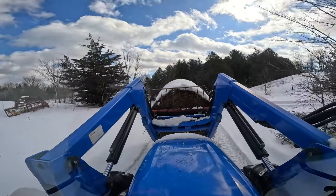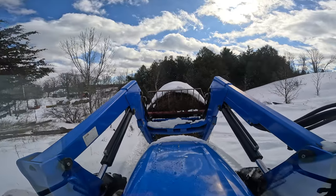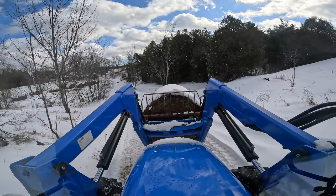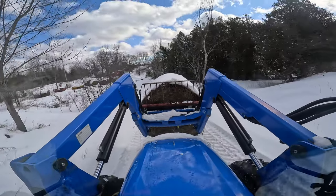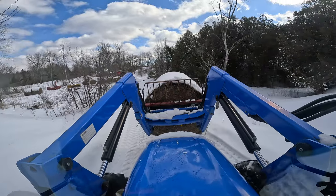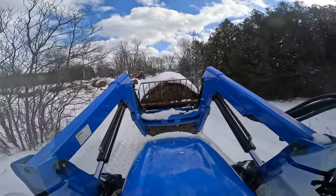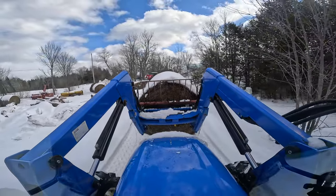The other thing you learn when going down hills like this: don't push in your clutch, because there's a really good chance you could end up with a runaway. Let your engine do the braking for you, and it does it quite nicely. That's quite a steep hill and I have no trouble with the engine doing the braking there.